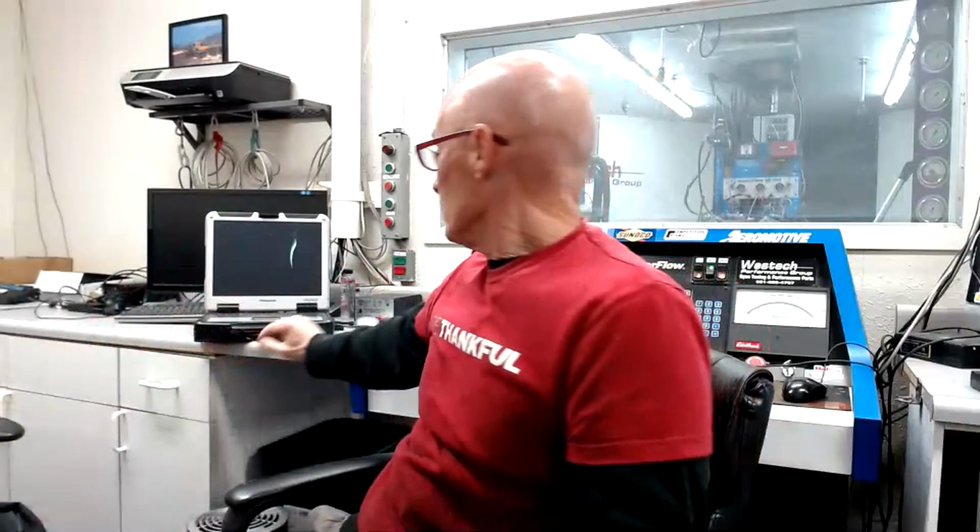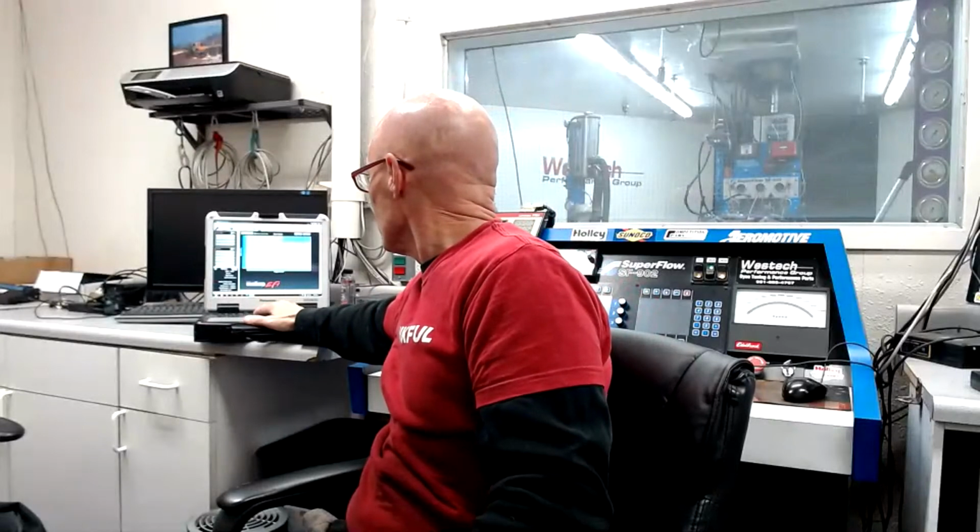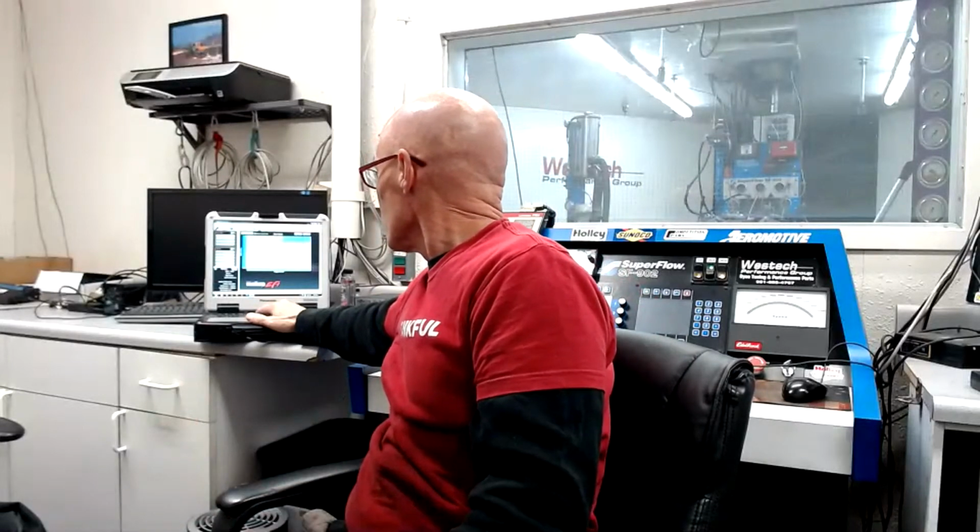I mean, we have the Holley hooked up. We have a program for it. Because I've been tuning this thing for a long time, we know what it does. It's very easy to add and subtract fuel and add and subtract timing. Although so far in the changes that we've made, timing changes haven't really shown very much. So it's the same timing for all of these combinations. Right now, it is flat at 30 degrees all the way through from 2,500 all the way up to 6,000 RPM. And it doesn't seem to want any more than that, but it also doesn't seem to want less than that. So it tells us what it wants and we give it that.